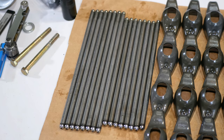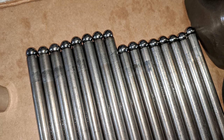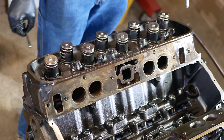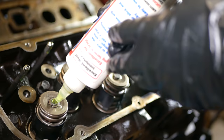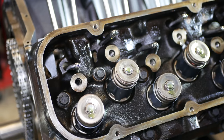Then it's time for the pushrods. I didn't keep the pushrods matched up with the rockers, but we will maintain their vertical orientation — each one is visibly scuffed on one side from passing through its pushrod guide plate, so we'll keep that end facing up. We'll also make sure the short and long pushrods end up in the right places: the exhaust valves get long pushrods while the intake valves get short ones. We'll fill out the driver side by dropping each pushrod into its respective lifter, then do the same for the eight pushrods on the passenger side. We'll go through and put assembly lube on the tip of each pushrod as well as on the tip of each valve stem. This will help ensure that the entire valve train stays lubricated during break-in and any test firings.